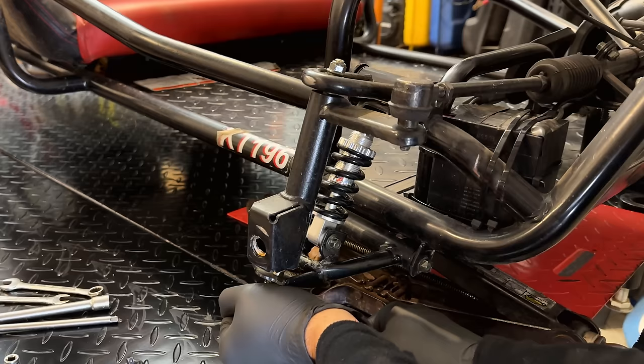That is fairly typical of these Honda clones, in the 200cc range like this one. The carbs are just lean out of the box. So I'm going to pull the pilot jet out, drill it up two or three sizes, and we'll try it again.